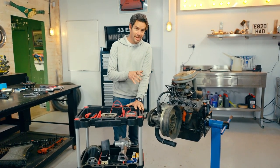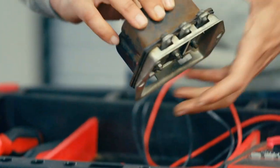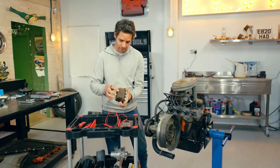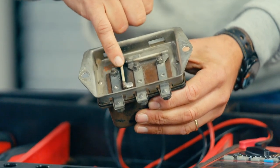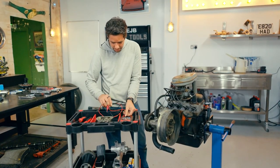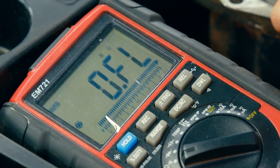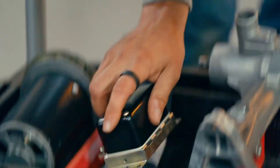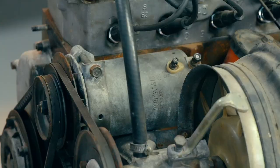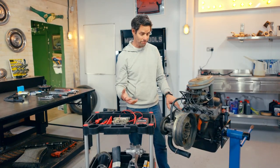I've got a couple of things I need to do to the engine before it goes back in the car: give it a service and a proper good clean up. As part of that I took the regulator off — it's all rusty and horrible — but when I turned it over, very clearly the resistor on the back is burnt out, and a quick check with a multimeter confirms it: absolutely no continuity from one end to the other. I can't get those resistors on their own — they just don't exist anymore — so I managed to find a replacement regulator. These things regulate the voltage output of the dynamo, and because I don't know the history of this car I don't know whether that fault was created inside the regulator or a failure of the circuitry, so I've taken the decision to replace them both.